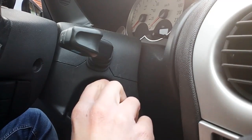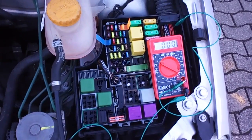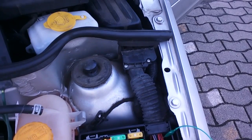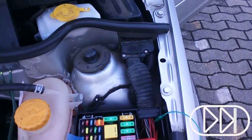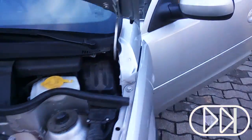After you've finished, remove your key from the lock and disconnect the battery. Now you need to find a way from your fuse box to the place where you want to mount your device. This is the part where it gets very car specific, and if you don't want to see how I did it in my car, you can skip the next few seconds.